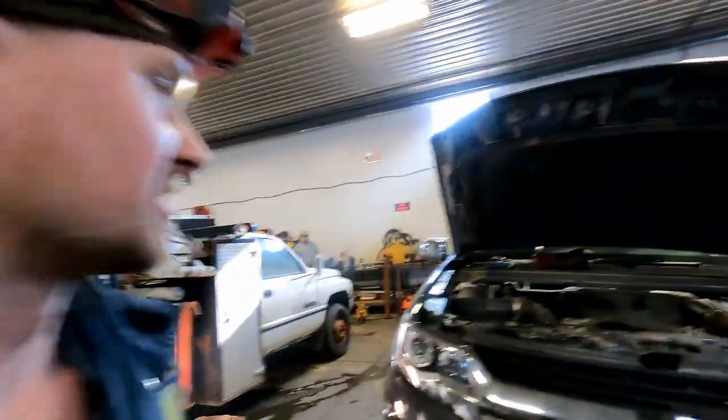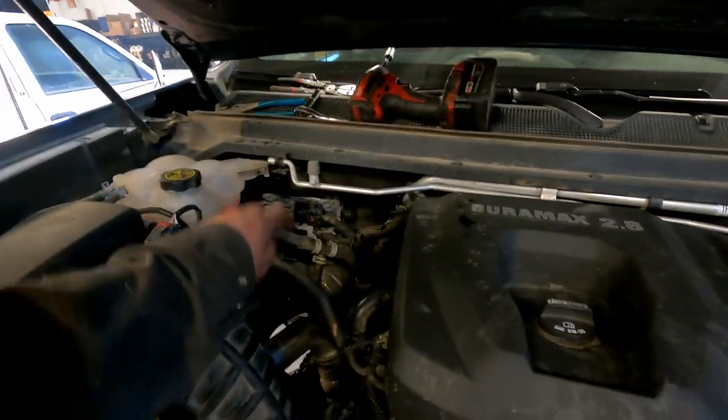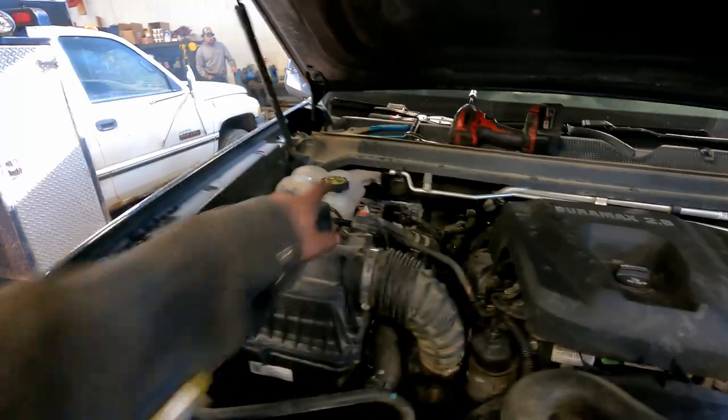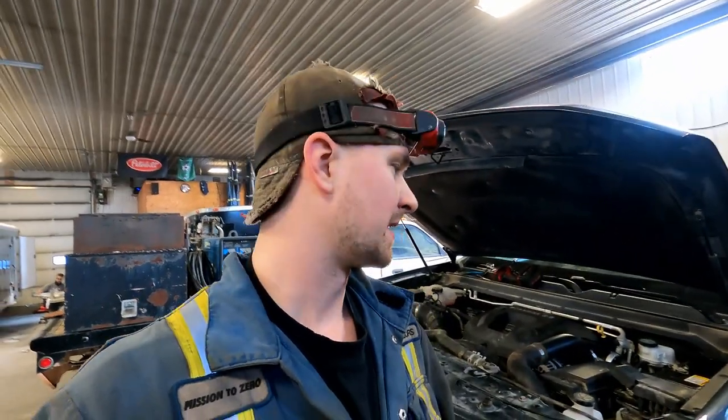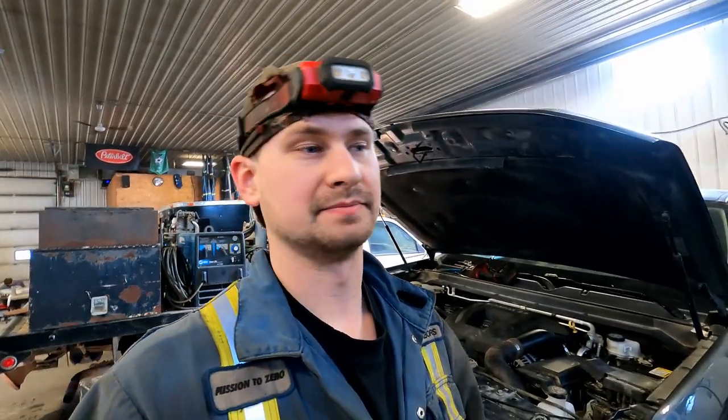That's it. Make sure you put your coolant lines back in and get your turbo VGT actuator plugged back in; top up your coolant if needed. According to my tuner you don't need to unplug any throttle valves or anything on the EGR side. Go underneath and check for exhaust leaks, and make sure all your wiring is tied up so it doesn't melt on the exhaust. If you've got questions, ask in the comments or message me on Instagram at Dark Iron Diesel. Please like and subscribe — I put a lot of effort into these videos so you can learn to do it yourself without paying someone else. Thanks for watching!